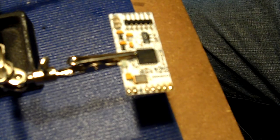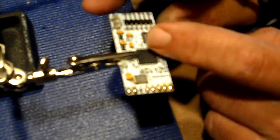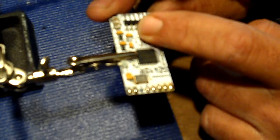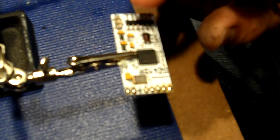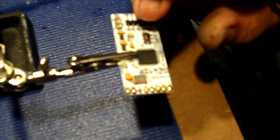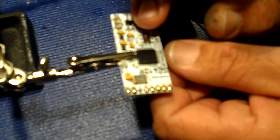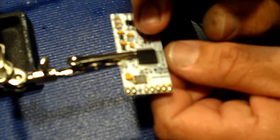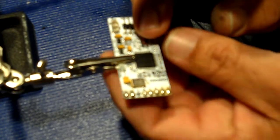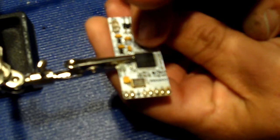Now what we're going to do, there was a trick with these, okay? Normally on a fat, you'd set it on fat. Well, there is a trick that you can do. You can take advantage of other timing files too, for the timing to glitch the board, and you'd be able to set it to slim and use those settings too.